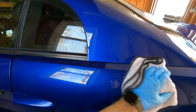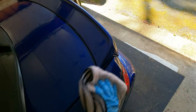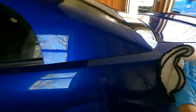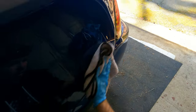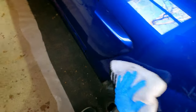Another thing you want to remember is why it's so important to make sure that your panel is wiped down with the prep and everything else. Once you put that ceramic coat on and it fully cures and dries, whatever is on the paint surface is going to get locked into it. There is no going back and picking out a hair or a scratch that you could have taken out but you didn't bother. That's going to get locked in there underneath the ceramic coat,